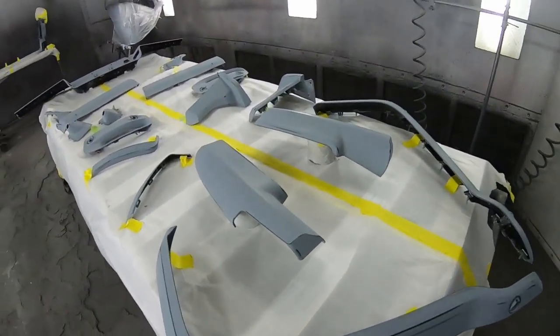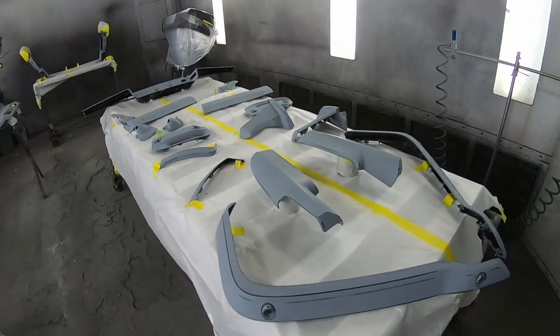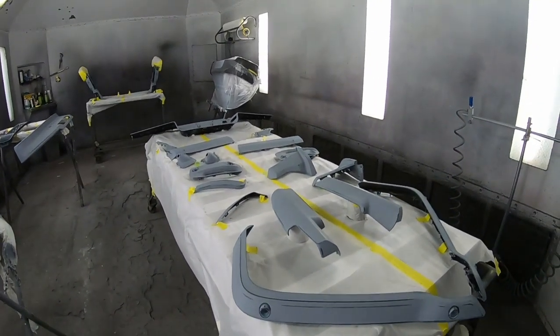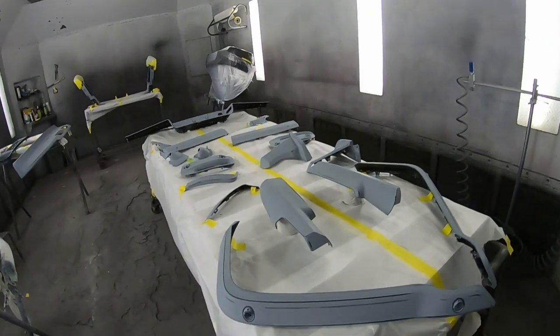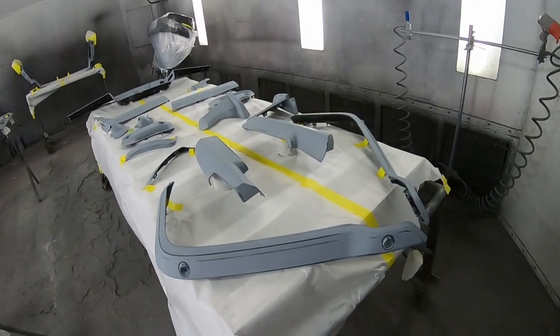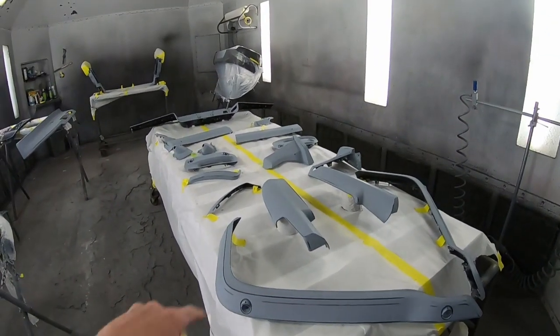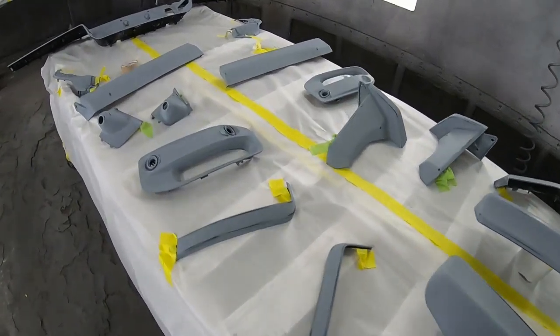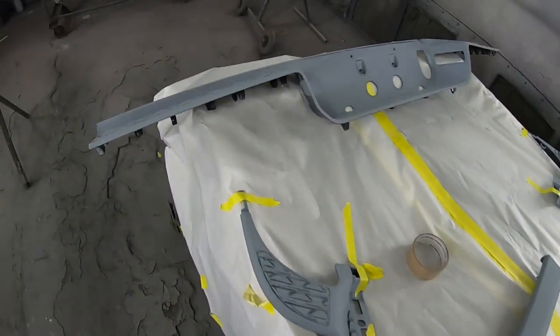All right, well, fast forward, didn't show you guys any of the priming or prepping process because it's pretty boring. And if you watch my Duramax Colormatched video or my Powerstroke Colormatched video, I go through all the steps. But basically, Scotch-Brite and prime them, wet sand them with like 400, clean them off, and they're ready to roll. So no texture on any of these parts anymore.